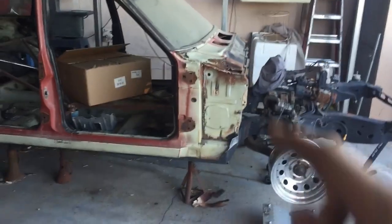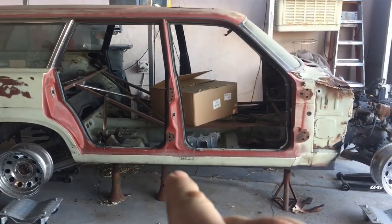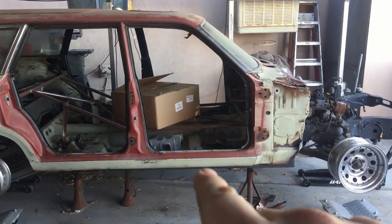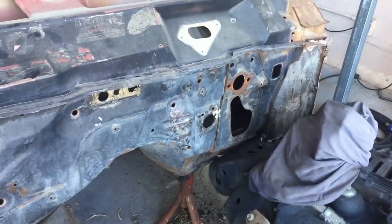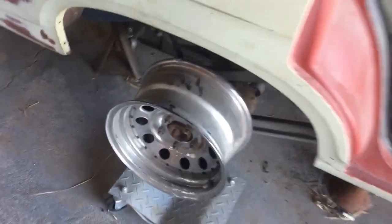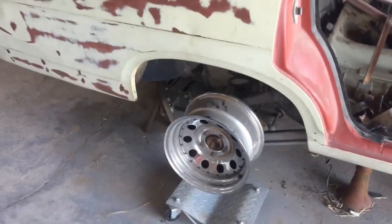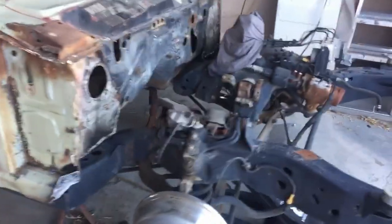I went ahead and clearanced both sides — this side of the floorboard has all the fiberglass off it, it's all rotted so that's going to have to be fixed anyway, but I just duplicated the other side. Now the big issue is all these rough edges down here. That little triangle that's sticking down needs to go — everything needs to be equal to this piece right here, so everything below that needs to go, but I'm going to have to do this all the way down on the inside of the roll pan. Now I'm removing the floor pan lip — the floor pan came up and was spot welded right here, and I just cut it previously. I tried a few methods — a Dremel, torch method, and the spot weld cutter — and the spot weld cutter really does seem to be doing the best right now. I just gotta peel all the rest of this out on both sides to finish cleaning up this last little clearance.